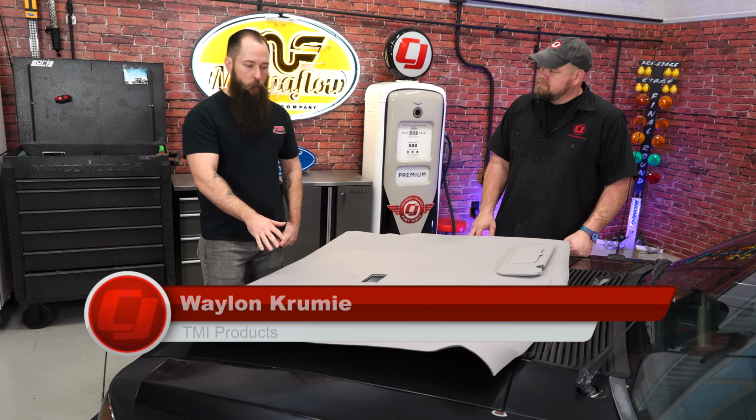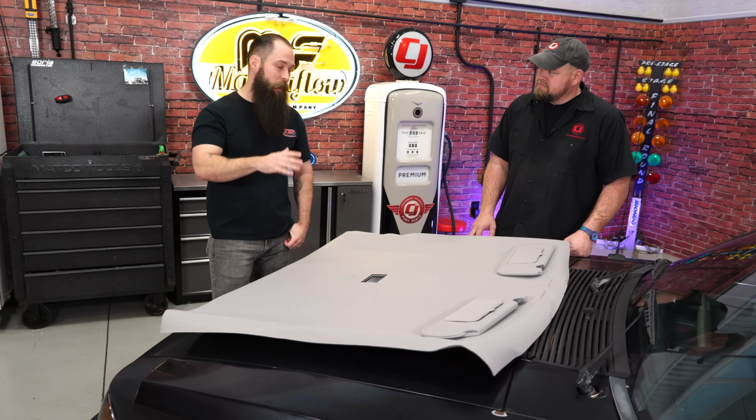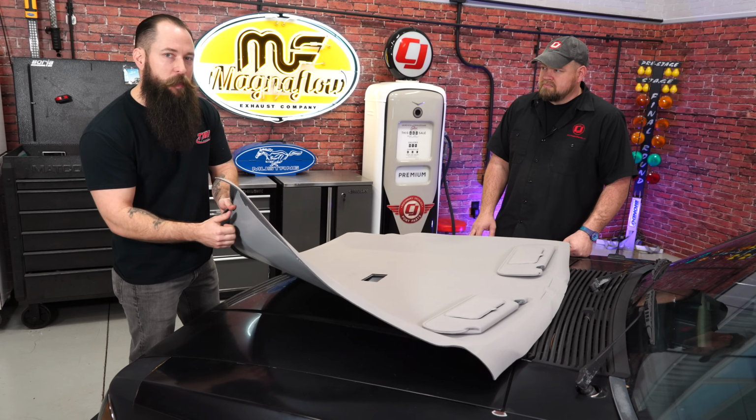Yeah, if you own an old Fox body like this, what you're going to find more often than not is that headliner adhesive is going to let go over time. You may have that cloth hitting you on the top of the head. So headliner is obviously a go-to. Also, I want to point out that originally that's a cardboard headliner. We do these in a waterproof ABS plastic.